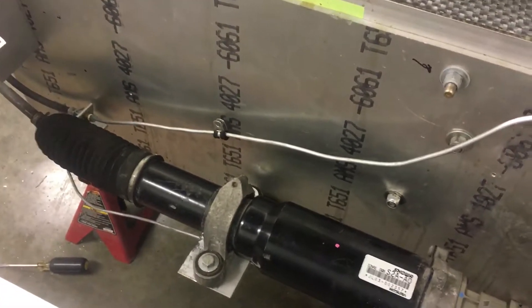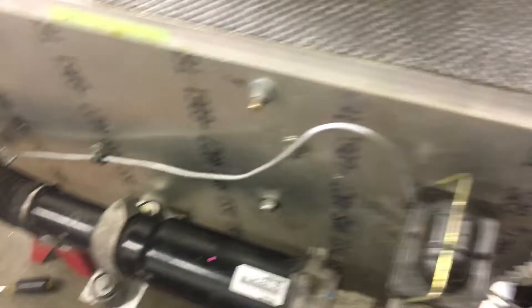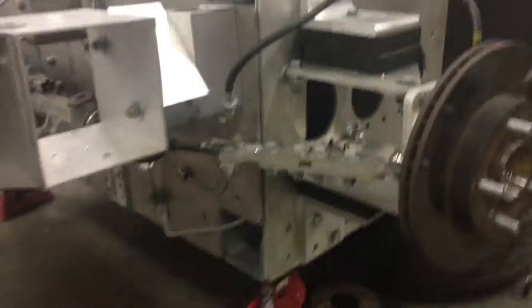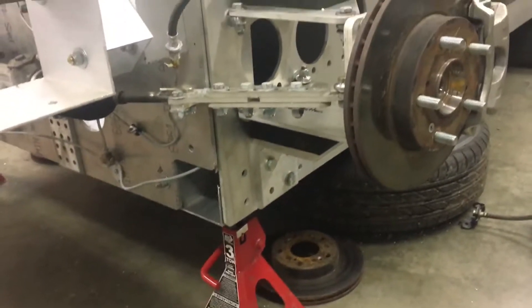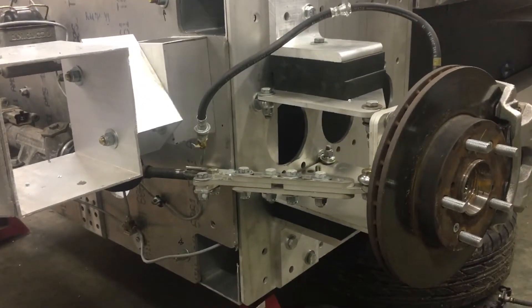I was thinking I might snake this through in the middle, depending on where I can actually mount it so that the brake line is not in the way of the steering mechanism when it's being steered left and right. We'll go through that some more during the next iteration, which may be next week as I'm taking a few days off for a VIP visit. Make sure that we have enough washers and the right thickness. I had to mix and match, which I didn't like, so I swapped out and went with the same thickness ones for the brakes, which are awesome.